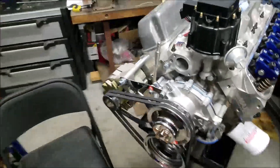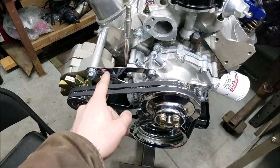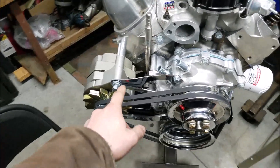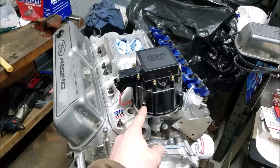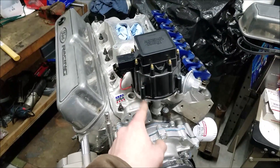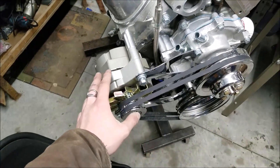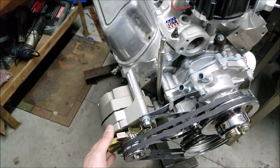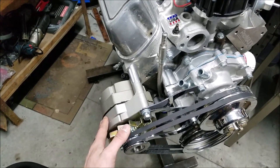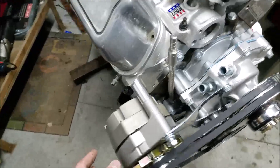Moving on from there, these are just standard old-school alternator brackets, which are extremely cheap and easy to come by — they're on Summit and I'll leave the part number below. That keeps with the old 60s style look, which I really like. Now I know you're going to question the HEI distributor when I'm talking about keeping with the 60s style — bear with me. We have a hybrid alternator here: it's a GM-style back end with a Ford-style front end. It is a one-wire unit from Tough Stuff Performance, and I've had pretty good luck with these running a lot of miles without any issues.